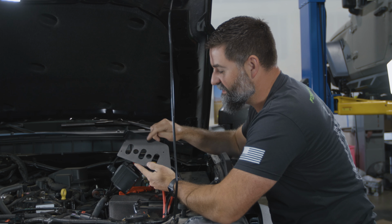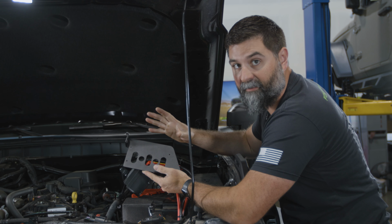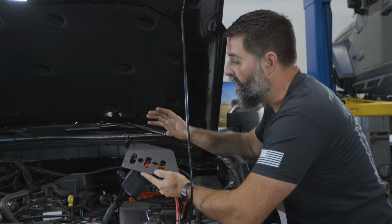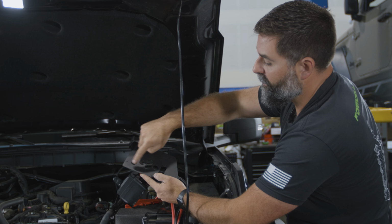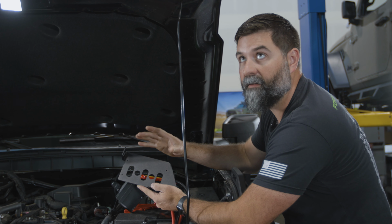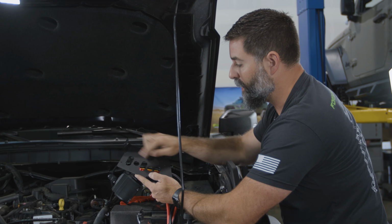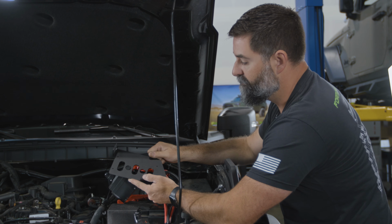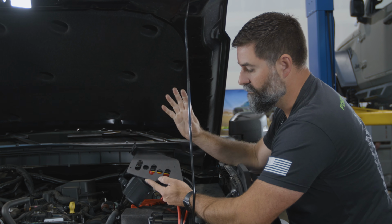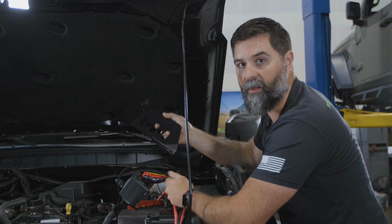All right, last point on this plate. You may be using somebody else's winch, which shame on you, get an Ironman winch. If you are, the pre-drilled holes for this box aren't gonna be set up for whatever box you're using, but not a big deal. Just mark your holes, punch a hole, drill it out, bolt it on. You can kind of make it universal. So this will work anywhere in the universe.